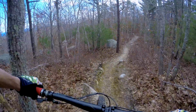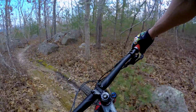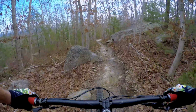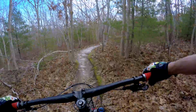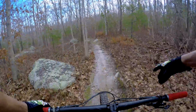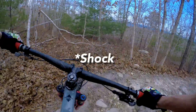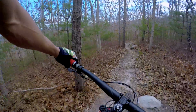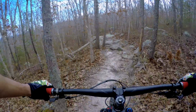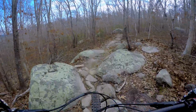But you know, the rear end's a Horst link design, like Specialized FSR suspension, and how they set up the kinematics or whatever you want to call it on the rear end is that it's supposed to be really progressive. So the whole shock doesn't have to be tuned to make the bike perform. So there's a light tune on the bike, which makes the shock move on any bump you hit. But because of the kinematics of the rear suspension, here we go.